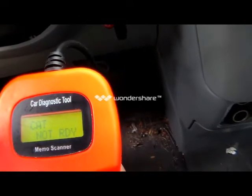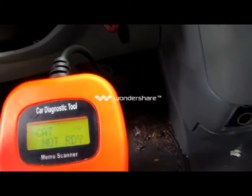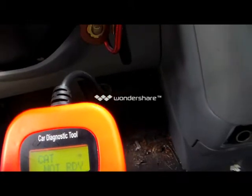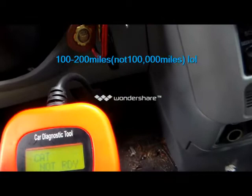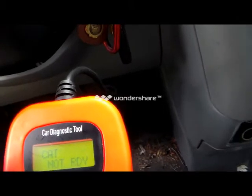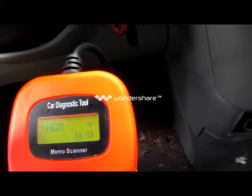The catalytic converter is not ready, so I still have to probably do a few drive cycles on this one to activate it. That's because about five days ago I just installed a new oxygen sensor, so it's going to take probably a few drives — some people say maybe drive it like a hundred miles or two hundred miles before your catalytic converter registers as ready.